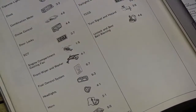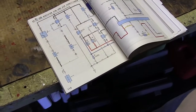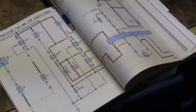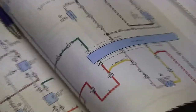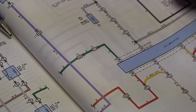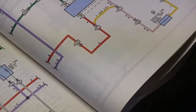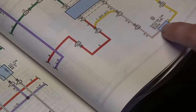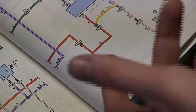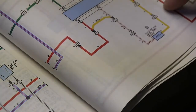The next one here is the radiator fan. We switch to the page that has the radiator fan and take a look. It's a little bit more complicated because if your system has AC as well, there's something called an AC amplifier, which is basically the computer for this circuit — for the air conditioning, for the radiator, and that kind of thing. What we actually see here, zooming in, is there's a radiator fan water temperature sensor. This is the same thing as the engine bay fan sensor — it's a thermistor, a thermally controlled resistor, which measures the temperature in the radiator. It's actually screwed into the radiator. If we manually disconnect this with a switch, we're sending infinity resistance to this computer, telling it to turn on the radiator fan.